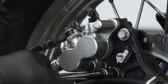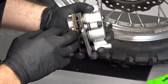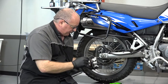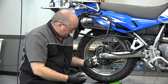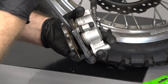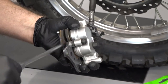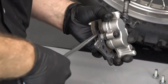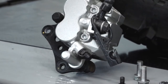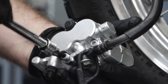Now we can get those out. Looking at these, they were actually in fantastic shape. The wear limit on these is that you can run it all the way down to a thickness of one millimeter. And these look practically new, but I do want to go ahead and show you the procedure of how to get them swapped out. Take a screwdriver and compress those pistons back into their bore — all the way back. Now we can go ahead and remove those two pins that actually run through the brake pads, held in place by just a 5mm Allen.